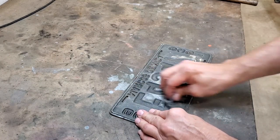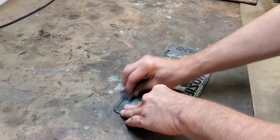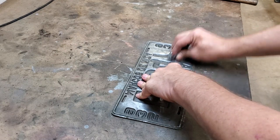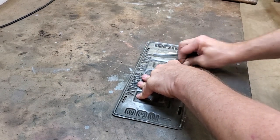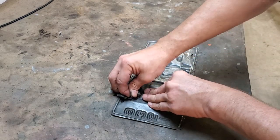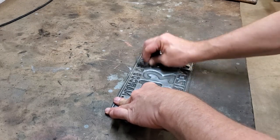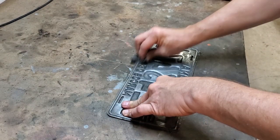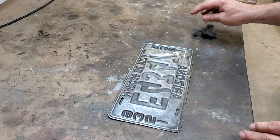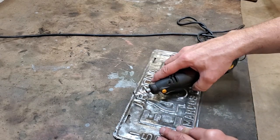That's the front side. Look at the back side — you can see how fast it's going to come off here. The back side, having been more protected in its life, is easier to work with. It comes off real fast, and this is quadruple-aught steel wool, so this isn't even a coarse steel wool. A nice quick way of removing the rest of what's on the license plate. Also, when you do this you notice spots that need more straightening, so I might make a trip back to the anvil. We've got a motor tool here with a wire brush so you can get into some of the smaller areas.